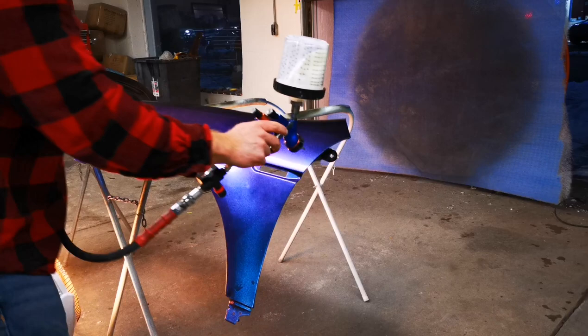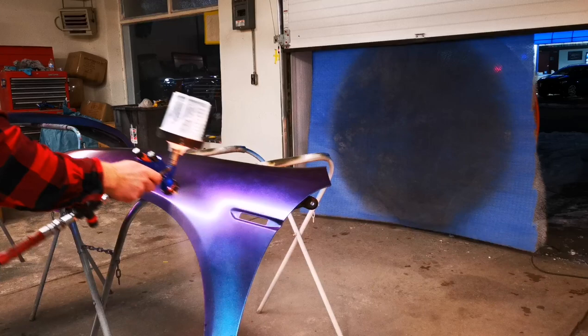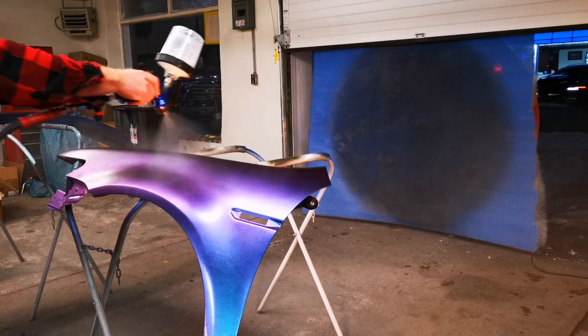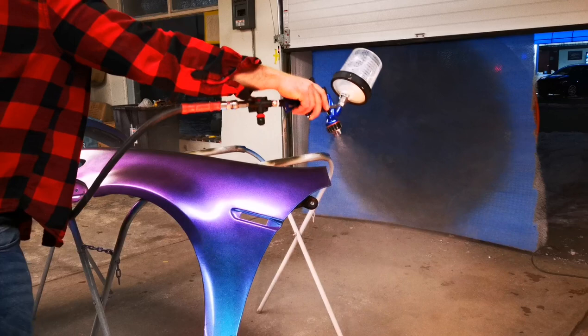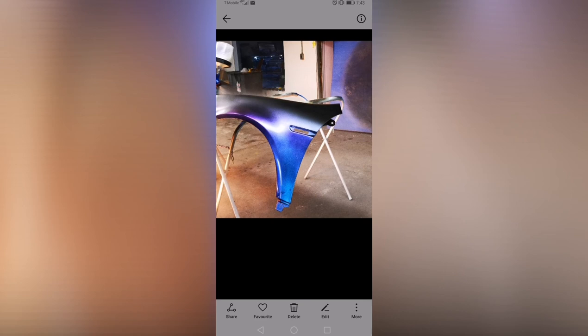This one I went medium wet on the first coat. Then on your second coat, that's when you kind of pull the gun back and just mist the paint on and get rid of that blotchiness from the first coat, because your first coat will always come out a little bit blotchy. Second coat is your control coat — clean all that up. And you can also do a third control coat if needed.